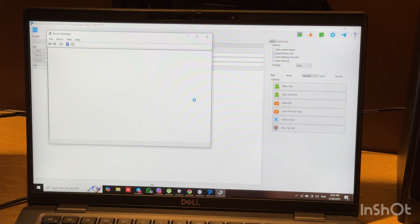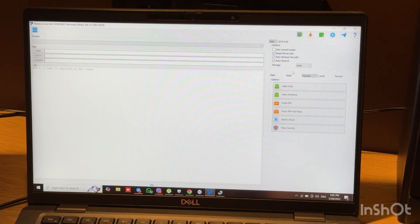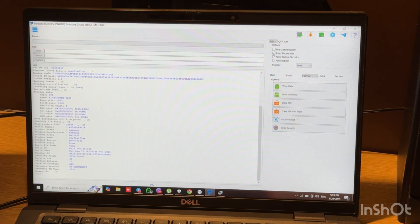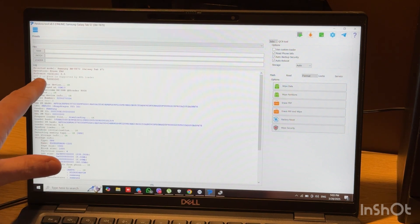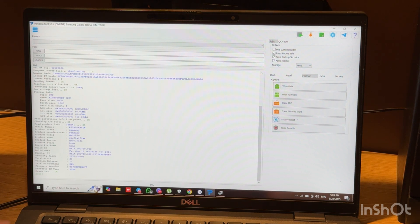You can make sure by checking Device Manager in the port submenu. After this, just go to the Format tab and press the Erase FRP button. Make sure that your device has firmware with supported bit — in software firehose up to bit 8 is supported currently for this model. We see the message 'Erase FRP OK', which means that FRP is erased.